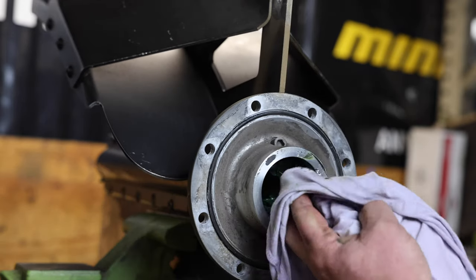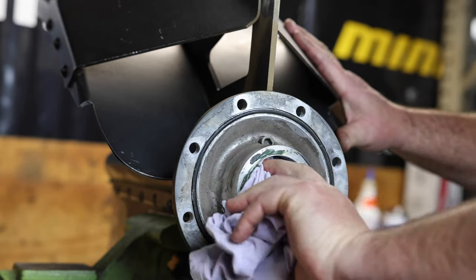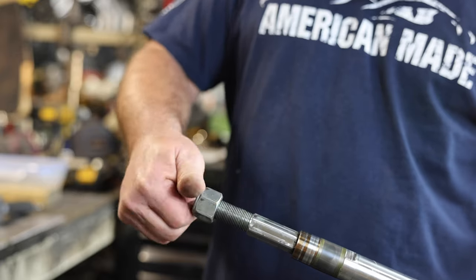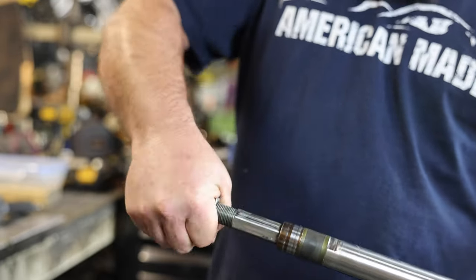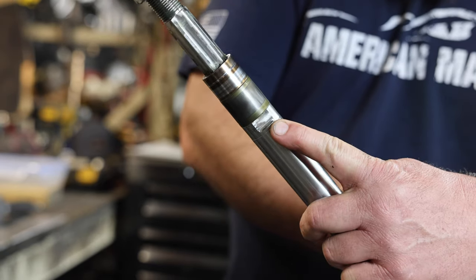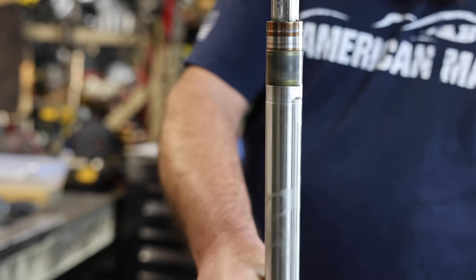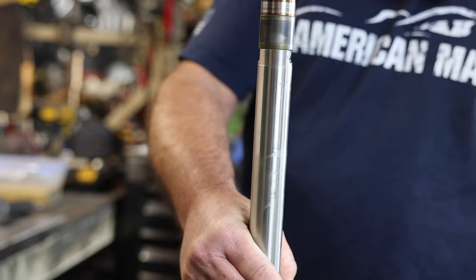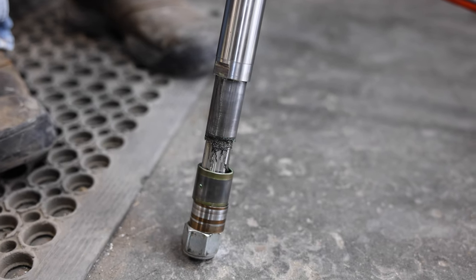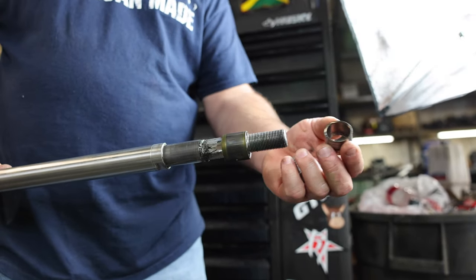Wipe out the flange and expose the inner seal and snap ring. This snap ring does not sit in a groove — it only sits in a small recess. Put the old prop nut back on. With an air chisel or a hammer and chisel, you can remove the bearing and seal sleeve. Put the chisel in the notch and hit towards the end of the prop shaft. Holding the shaft on the ground at a slight angle, you can air chisel the bearing and the seal sleeve off pretty easily. It is a pressed fit — you don't want it to come off easy or go back on easy. Remove the old nut, sleeve, and bearing.